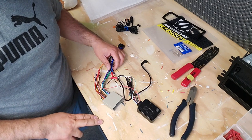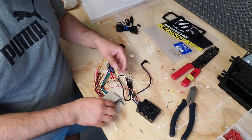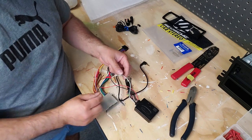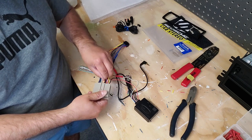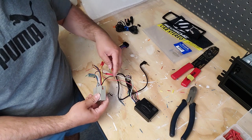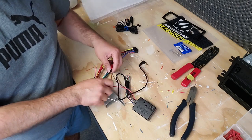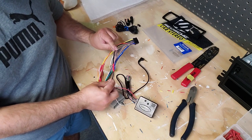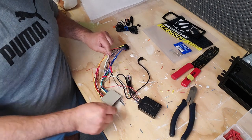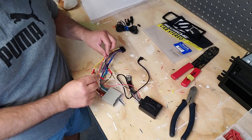Just to show you the connections I've been making: for the steering wheel control, SWC1 — I'm using the white/green wire, which is pin 18, and that goes to the bottom of the factory harness. That's the only wire needed for steering wheel control. The module also needs ground, so I've combined the two grounds: one goes to the factory connector combined with the one going to the new radio harness. I've done the exact same thing for the accessory red wire and yellow wire.